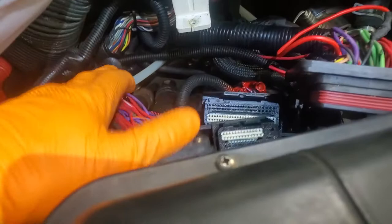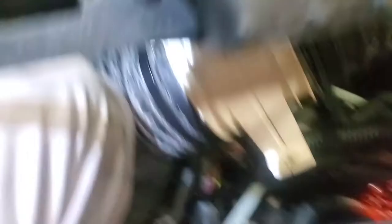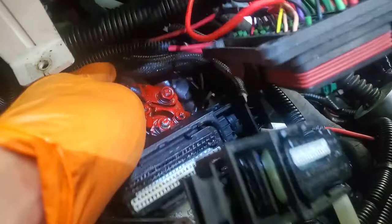Those relays will not want to come out of there, but go ahead and take these off — and here we are, this is how you get access to the bottom. This is what you're going to need to do for oil changes. Now that you have this off you can weasel your hand down in here and try to get the oil filter off, which is down there where those tubes are. The differentials are back there, the reverse motor is right back here underneath, and the starter motor is right here. Some of this is not factory — we'll get into all of that very soon.